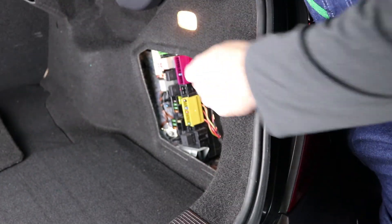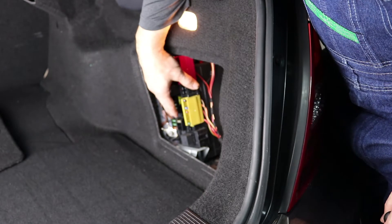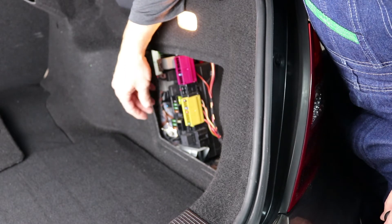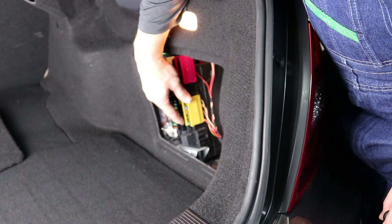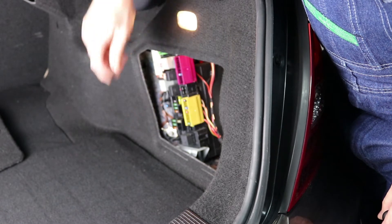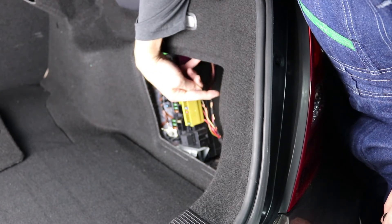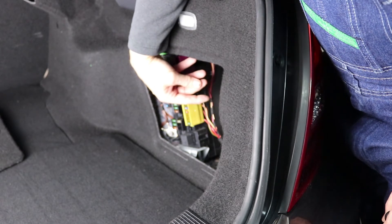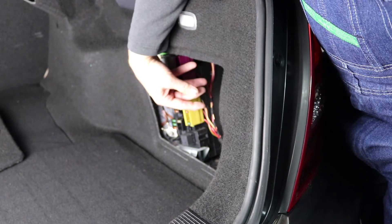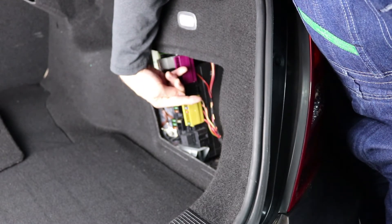Put the panel cover to the side. Right behind it on the passenger side of the vehicle, there's a fuse box that controls almost all of your lighting and several other power processes for the car. There's also another one underneath the driver's door and one underneath the hood, but this is one of the major ones for the C300. I'm going to get into position with a smaller camera and show you exactly what the bracket looks like and how to snap that cover off to get to the bulbs.